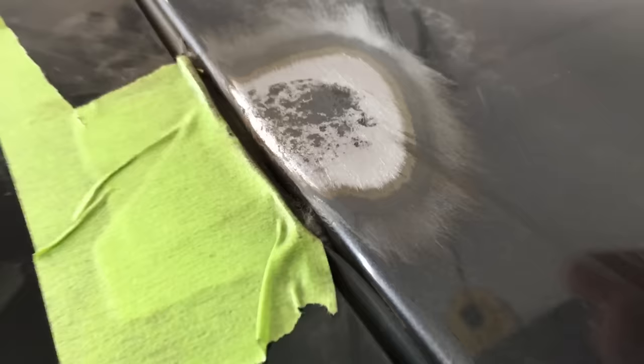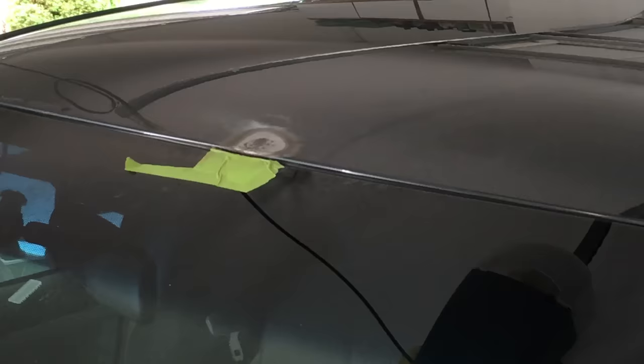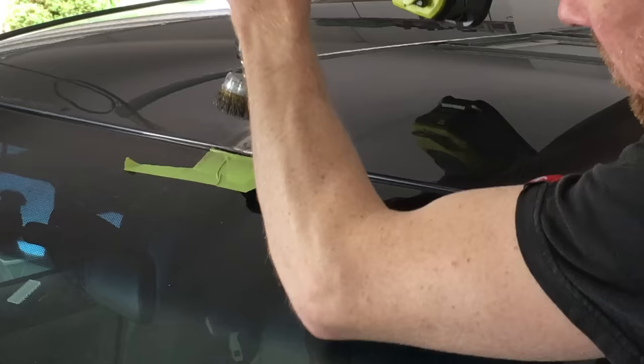That's bare metal, but I see some pitting from the rust. I can feel it when I drag a fingernail across the top — that's going to require some body filler to make it smooth before painting. First I'm going over the pitted area once more with the wire brush, since those bristles should be able to get down into those tiny pits and brush out any remaining rust that I didn't get with the flat sandpaper. All rust must go.